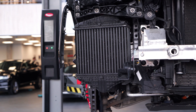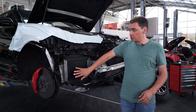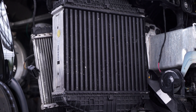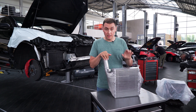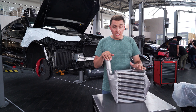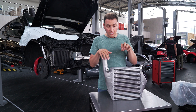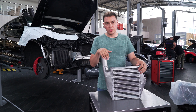Here you can see the factory intercooler — its design and its size. It has plastic end tanks and a pretty modest core. That core gets bombarded by rocks to the point where a tube can even rupture. Our design addresses both of those issues. We're pioneering the use of protective corrugation — protective fins — where the outer 3mm layer is made from a very hard metal that a rock won't damage. The core is very effective and the tanks ensure minimal pressure loss. This unit will provide maximum efficiency and reliability.